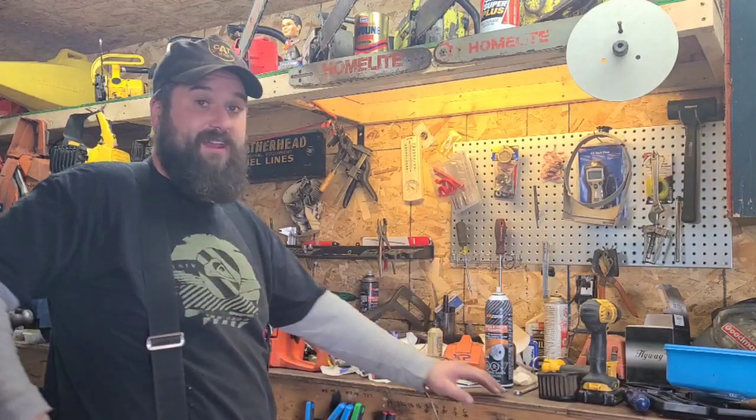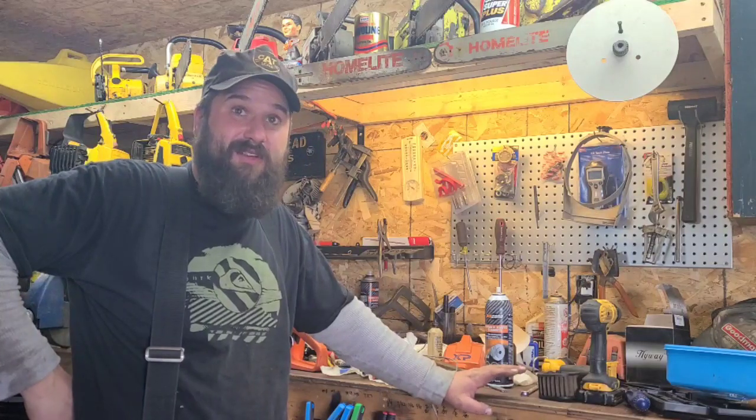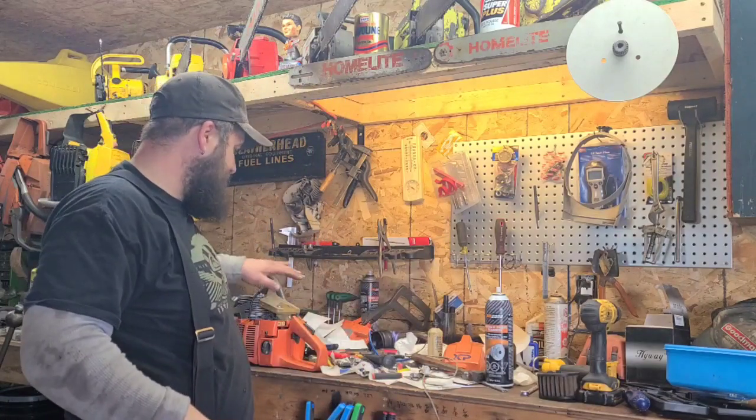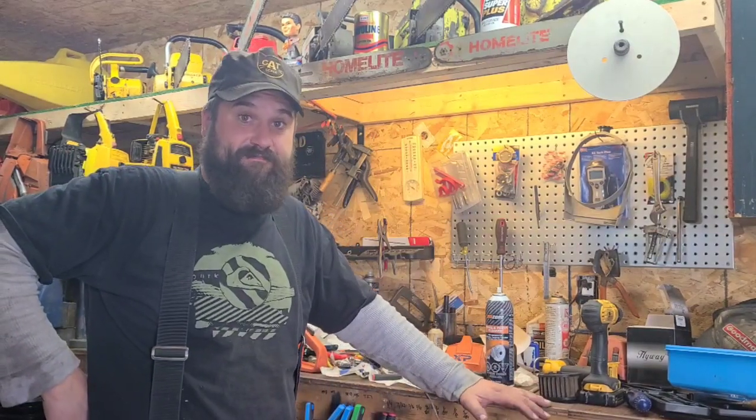It's time for dinner — I'm late, I was supposed to be in the house earlier, sorry honey. But we've got a running power saw. We still got to heat cycle this, I've got to dial in the carb — I think the metering lever is a touch too high. If I lower it a little bit it's loading up right away at idle, so that's probably the deal. I'll have to pull the carb down and have a look, but it runs, it starts, it idles somewhat. We don't have an air leak — I did a vacuum pressure test, we're good there. You can hear the air moving through that thing — it's gonna be an animal, I hope. As always, thanks for watching, take it easy, and stay tuned for more of this saw as we heat cycle it and pipe it.